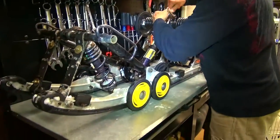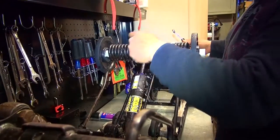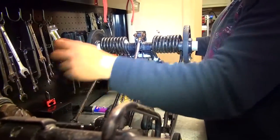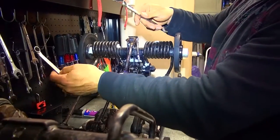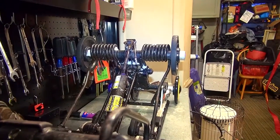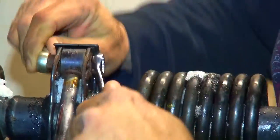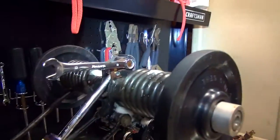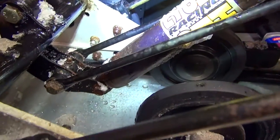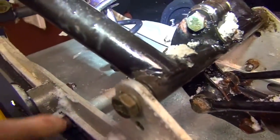So we got the skid up here on the workbench. Better remove the two shocks. I think they're 14 millimeter. Actually I think it's a half inch — they're just kind of gummed up. 13 is fitting. It is a Ski-Doo so it could be metric. So we've got a bolt up here and a bolt down there. On this forward shock, we've got to remove this idler wheel and then there are Allen bolts down there — it goes all the way through like an axle bolt — and then a bolt up here.